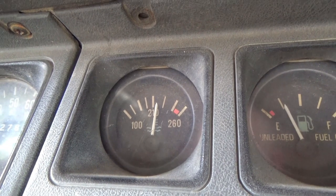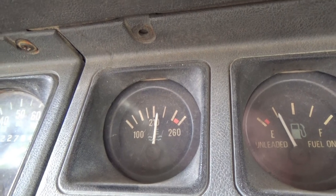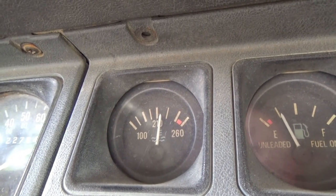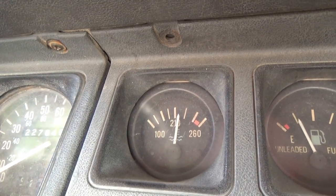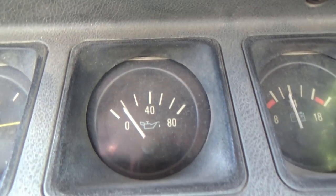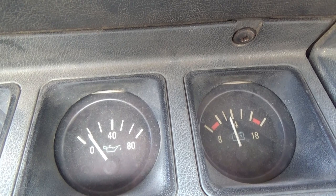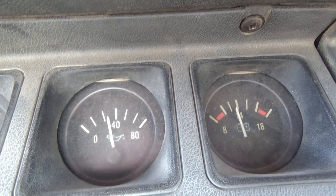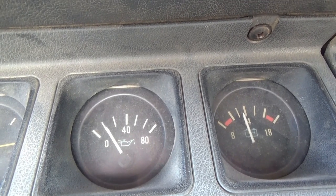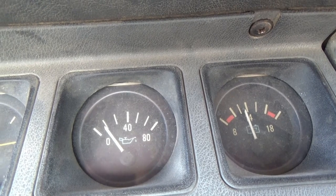After she's been sitting there idling for probably closer to 20 minutes or so, it's running about 215 to 220. Now this Jeep, this is about where it runs all the time — no, it's not running hot, it doesn't puke water or anything like that. This is about where this rig runs when it's warmed up this hot sitting still. Once I get going down the road a little bit it does cool down to about 210 or so. But the real subject — boom — there's the oil pressure. You see it's sitting rock steady, no fluctuation, no jumping. I've been spot-checking every so often between camera shoots. It was in fact the oil pressure sending unit. I can give it a little bit of gas and it jumps up there all smooth, cuts back down, settles back in place. So the oil pressure sending unit was in fact the issue. I've got steady oil pressure in my rig.